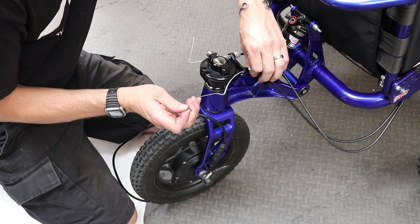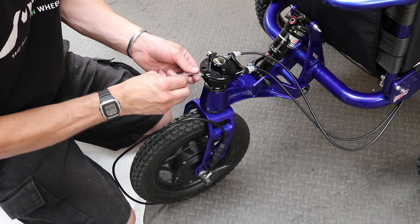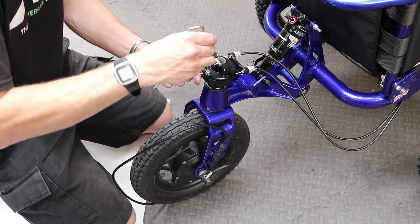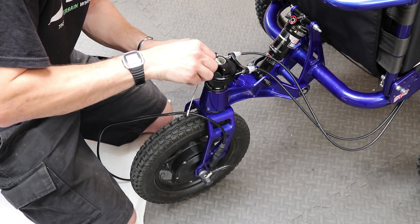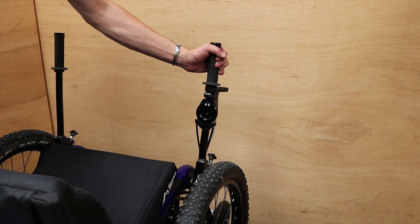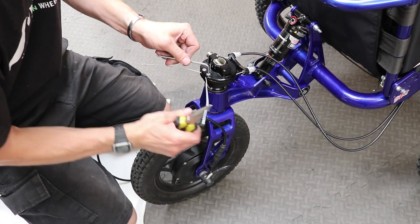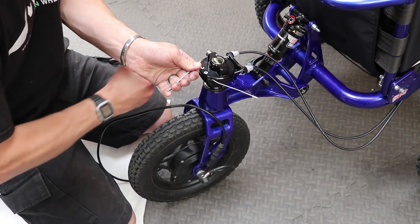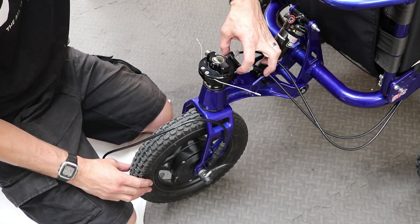Fit the second barrel adjuster, locate the cable and then fit the cable to the other side of the terminal. Screw in the second barrel adjuster, locate the cable, and then pull the cables through. Now screw in the cable clamp bolts, making sure that the washer sits nicely on top of the cable. Tighten the bolts loosely — it helps to have someone hold the steering handle straight while you pull the cables tight. Pull the cable tight with pliers, then tighten up the bolt with the 4mm Allen key. Make sure the cables are tight before proceeding.